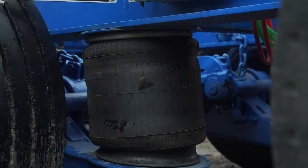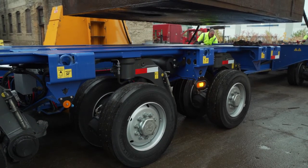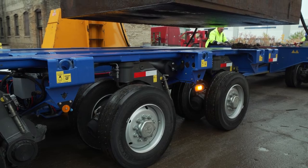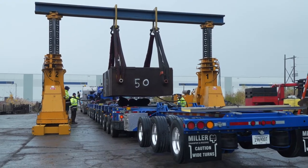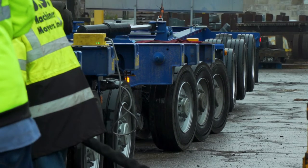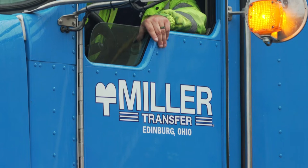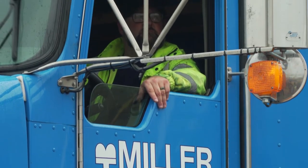I can raise and lower the trailer height. Ride height on this is 42 inches. I can raise it to 56 if I've got an obstacle in the way. With the traditional 19 axle, when you're backing up, there's always a Tillerman back there. With this, if I get into a situation where I would need one, I have the support of him back there — he can steer the trailer. All I'm really doing is watching the front end.